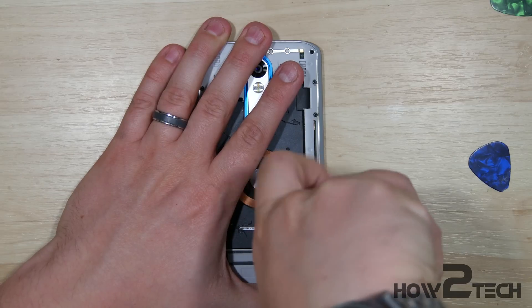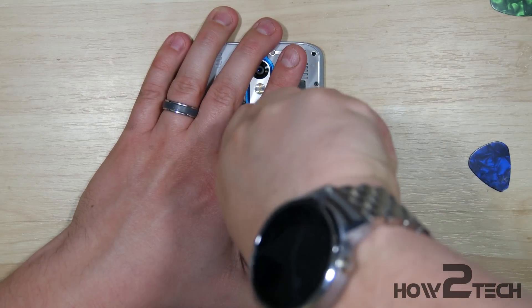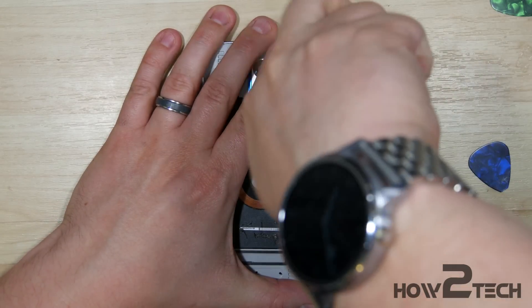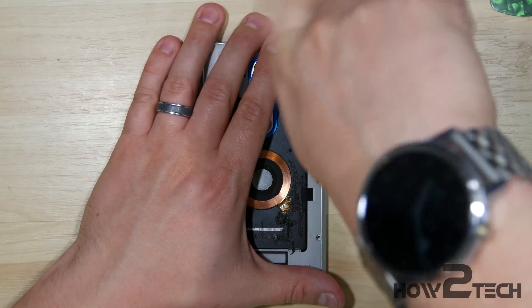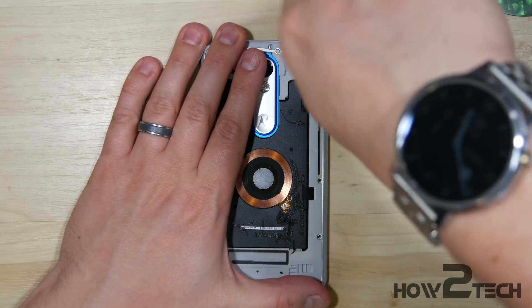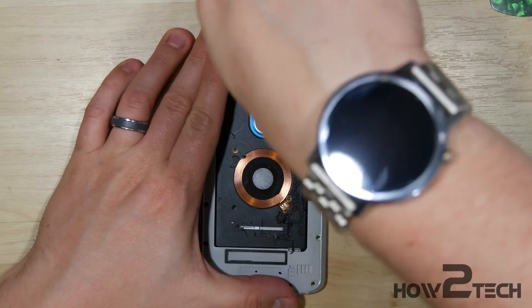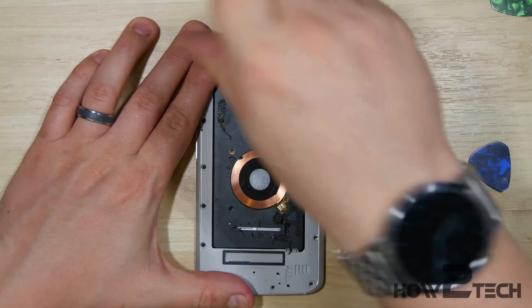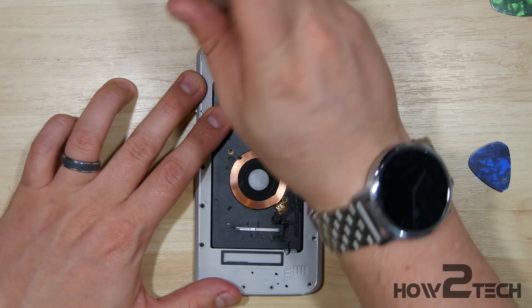So we're just going to unscrew these and work our way down the side. And before anybody says it, yes, I could have fast-forwarded to this part — but the point is, as you can see, how long it takes to disassemble this. One thing you notice with these Moto phones lately is these screws are in there so tight. You want to make sure you have the correct fitting Torx — it could be a size 3 out of your collection that fits better; in mine it's a size 4. I use iFixit tools. So just be careful — you don't want to strip any of these screws. You want to press down firmly and then twist to pull the screws out of their holes. Damaging a screw head can get it lodged in the back of the phone, and that can take quite some time to get removed.